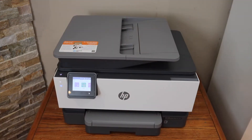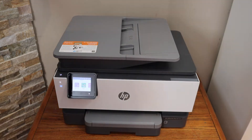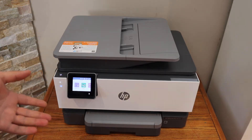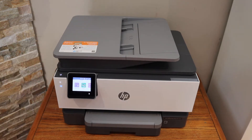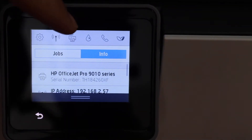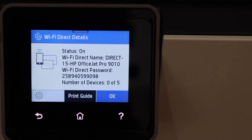In this video I am going to show you how to do the Wi-Fi Direct setup of your HP OfficeJet Pro 9015E printer. The first thing is to find out the password, activate the Wi-Fi Direct, and then we will add this printer to our device like an iPhone. Go to the printer control panel, scroll down the top bar, and select the Wi-Fi Direct icon — it will display the name of your printer Wi-Fi.